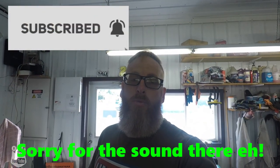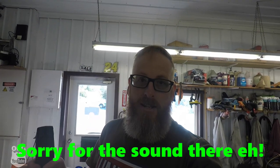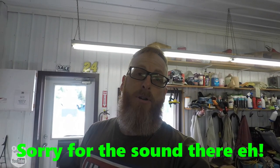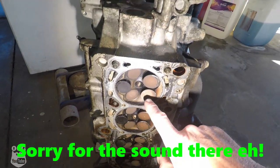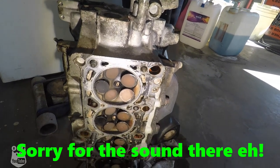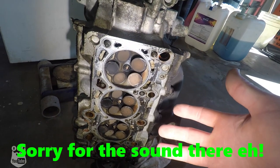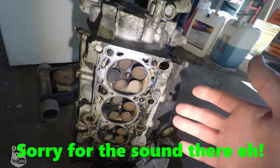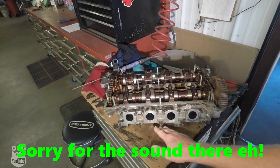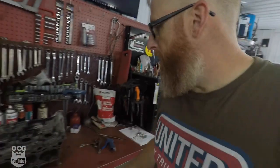The reason I have to replace the head is because when the timing belt goes bad, there's such minimal clearance between the head of the cylinder and the flat surface of the head that the valves come in contact with the piston. You can see the exhaust valves are wide open on all four cylinders and this outside intake valve is stuck on all four cylinders — zero compression — so the head is basically garbage. We've got a newer one out of another vehicle that we're swapping the manifolds onto and getting ready to set in place.